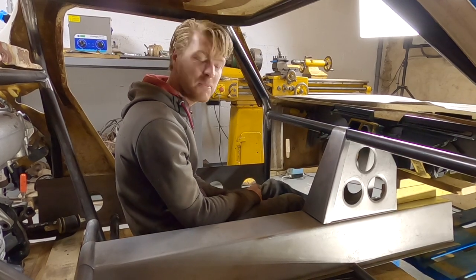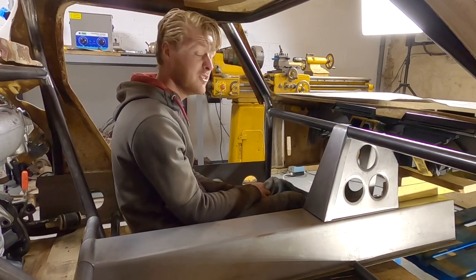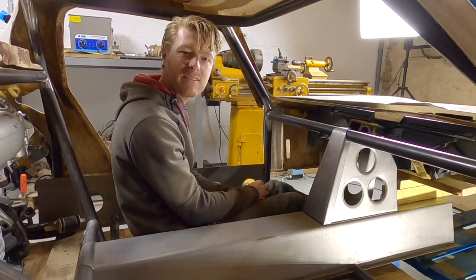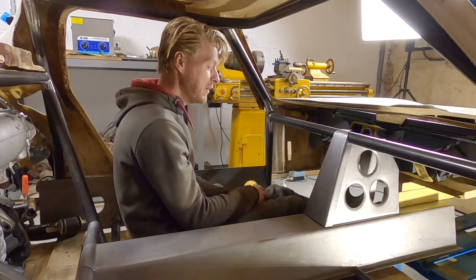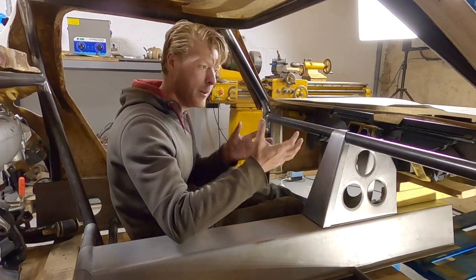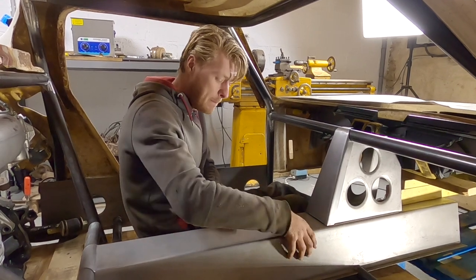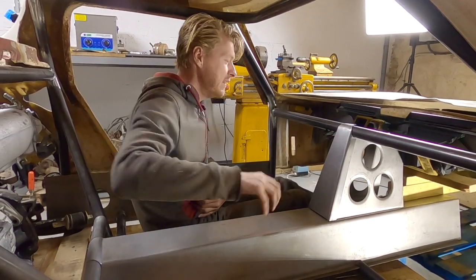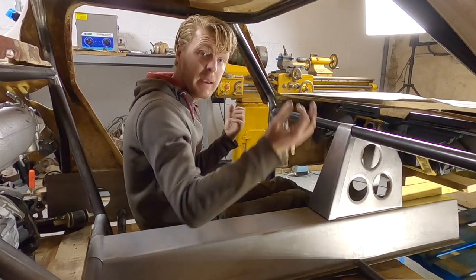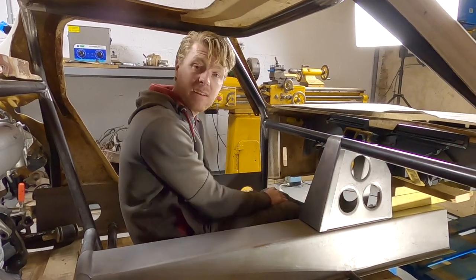It's a very nice way to make a very small car not feel claustrophobic, which is obviously important, especially on long journeys and stuff like that. If you're in a tiny room, it has to be a nice tiny room, doesn't it? And because it's not all sealed boxes, it's not going to be super boomy, which is another thing that can happen when you have cars that have big metal elements like this. You get a lot of vibration through the car and the entire car turns into a big bass speaker. So obviously these won't rattle because they're a lot stiffer than just a flat panel.